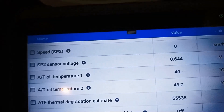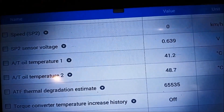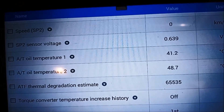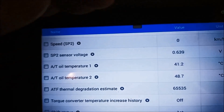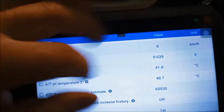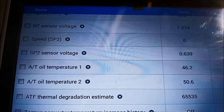Just go through the gears and back in the park. We're on 40-41 on one and 48 on the other — so that would be about the mid range. We're just going to get a little bit hotter because he does a bit more towing. We want that oil level at the lower mark — it'll be hotter, so it'll run over that little tube, meaning it'll be at the lower end. If you want it at the higher end, you'd check it at the lower temperature. We're on temperature sensor one at 46.2 and the other one's on 50, so that'll be the mid range.